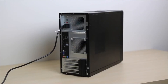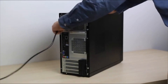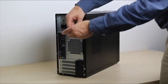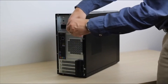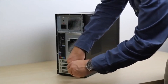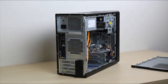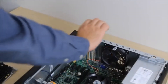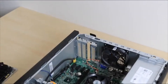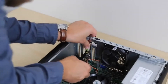Once downloaded, you will need to power down your PC and remove the power cord. Remember, never work on a PC while it still has power running to it. Now open your PC's case, usually by removing a side panel. If you have a low-profile PC, you may need to change the bracket connected to the card before installing. Locate the expansion slot you would like to use and remove the back cover. Install the card by firmly pressing it into the expansion slot.